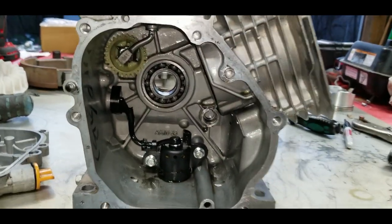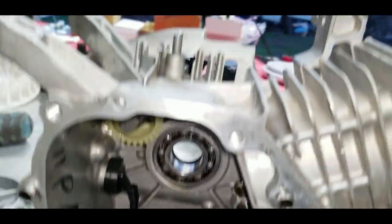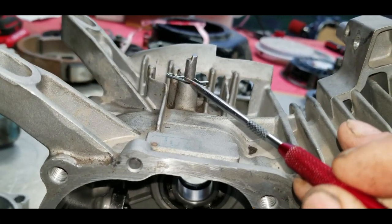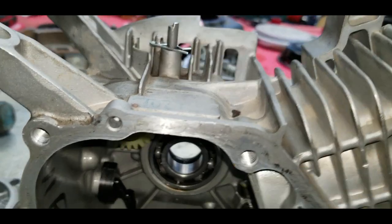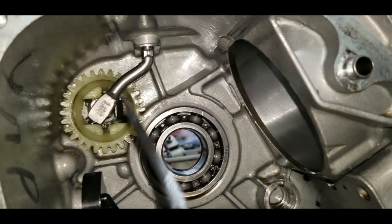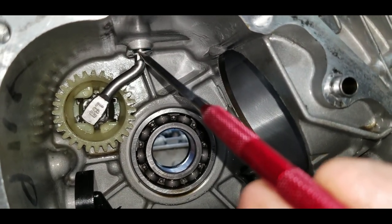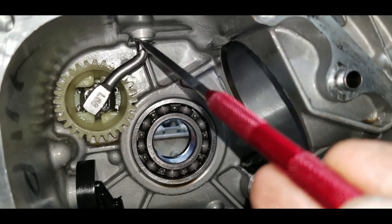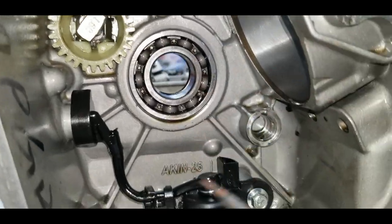you can pull the side cover off, crankshaft, all that stuff is still in place. And basically what it is once you pull the little lever off here, you can take a cutoff wheel and cut just above this clip, cut that off. And that will give you enough room after you remove that clip. This arm here will drop. Now don't forget, especially if you've ran it at all, if you're gonna do that, don't forget to remove this little washer up here. Because if you forget that, then it could fall down into your cam gear and all that stuff, and it's not good.